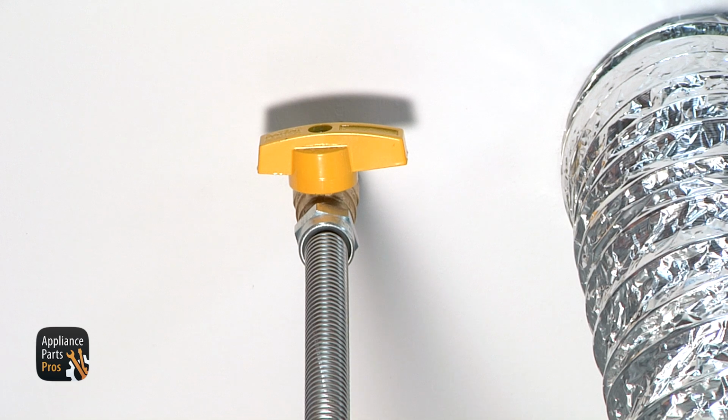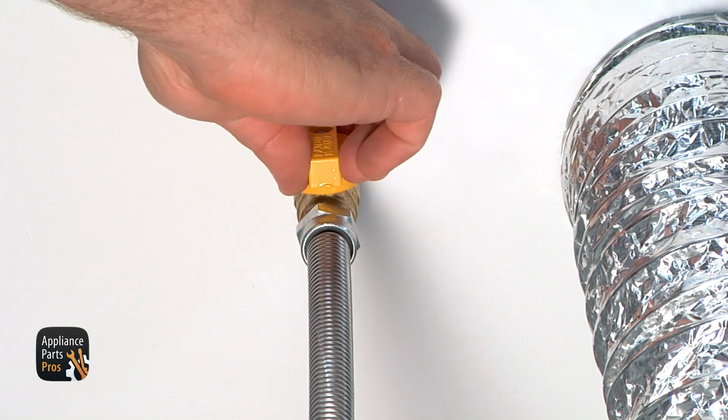That is the sign of bad control coils or a sticking valve. In both cases, the gas valve needs to be replaced. Oh, and just in case, check if the gas shutoff valve behind the dryer is open. If gas won't ignite, you can run a resistance test of the gas valve coils as a second test.